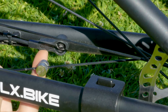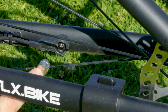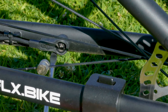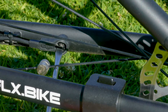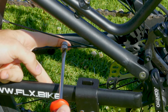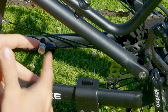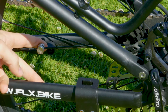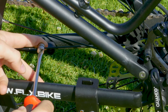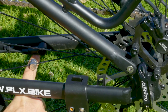You've got this mounting bolt, and it's actually the rectangular part here which houses the electronics and the speed sensor. So we want to line up the magnet with the rectangular part. Those are perfectly in line — it should not be in line with the circular mounting part. All you've got to do is move the magnet so you can access it with the screwdriver, loosen it, and slide it so that it's in line with the speed sensor. Make sure the magnet on the other side is flat, then tighten it up and rotate it back. Now I can see that it's in line.